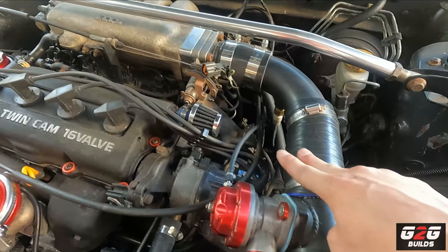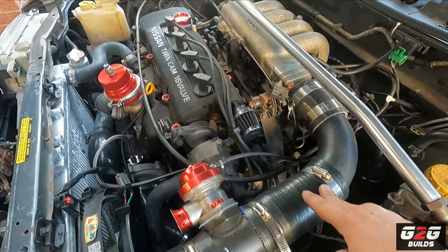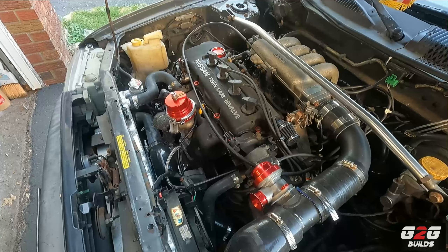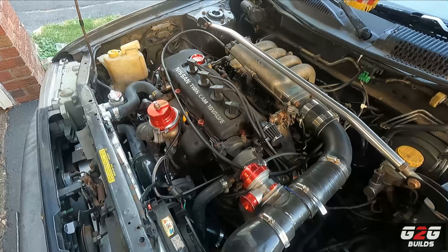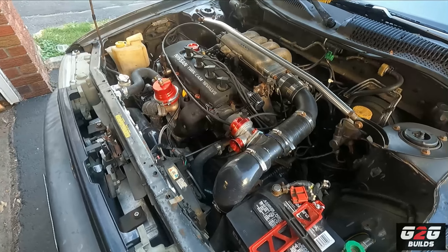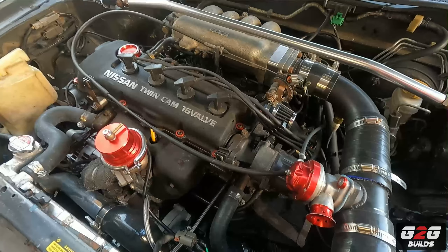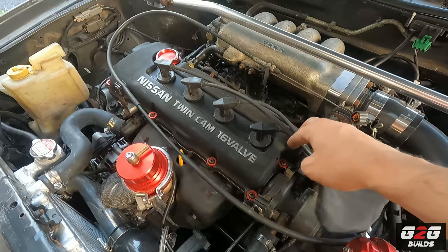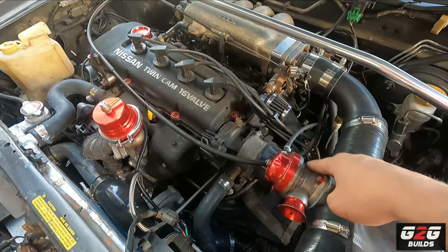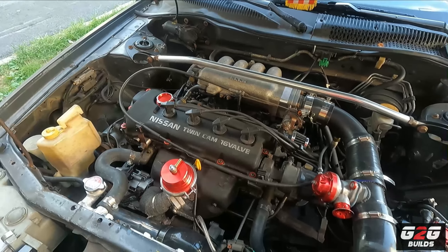What we're gonna do now: I'm gonna pull out the ignition coil first, then after that replace the spark plugs and the wiring. A quick piece of advice — this is not a tutorial and I'm not gonna be helping anybody do this. I don't have any wiring diagrams, so please don't message me asking for one. Also, if you decide to do it yourself, I recommend doing one plug at a time because it's very easy to get confused on the coil and change the firing order, which will make your car not start.